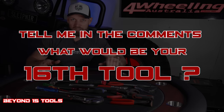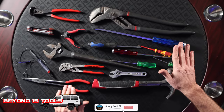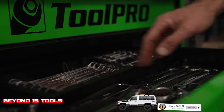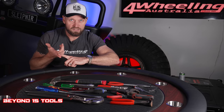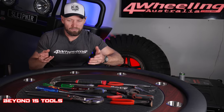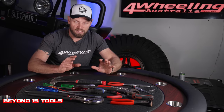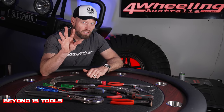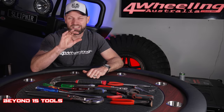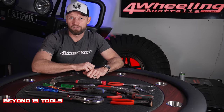If you had to add anything to the list as a number 16 or bonus item, tell me down below and hit that subscribe button. You can add more stuff, but when you add socket sets and spanner sets, just be selective of the sizes you bring — maybe just the common ones like 10, 12, 17, 19, and 13 for Toyota. When it comes to socket sets, there's nothing here that can substitute a ratchet and socket in some situations, but cut it down — figure out the five most-used sockets on your vehicle and don't bring the whole box. Do you carry all of these? Hit that like button, subscribe if you haven't already, and I'll see you next week.